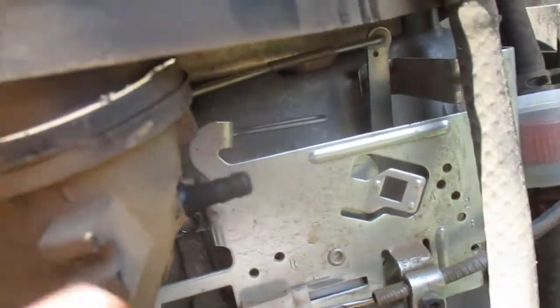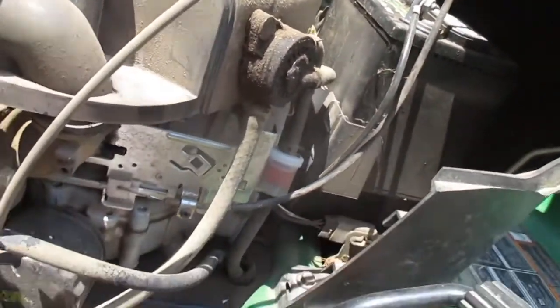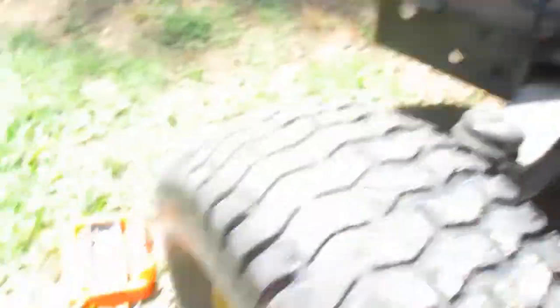This is built for a separate choke — you could put a cable right there. You're just gonna unhook both of these from the throttle system. Let me see if I can loosen them up. You see they're just wrapped around — you can kind of wiggle them and they come out. There's also a hose right there, a crankcase breather. I need to pry that off. There's also a screw right there. I removed it and found a few things — you've got to take off this breather, and there's a nut there too.